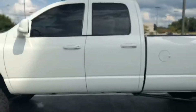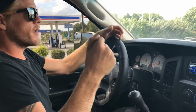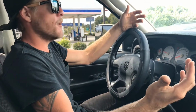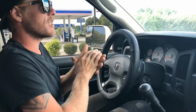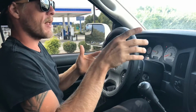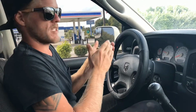So I just had to hop out real quick and show you guys that one more thing. Even over this thing. Amazing. One more thing that you're liable to encounter whenever you lift your vehicle and put oversized wheels and tires on it is your speedometer will need to be recalibrated. Ashton's Jeep, we put 35s on it with 17s. I think it knocked it off somewhere around 5 mile an hour. Maybe even a little better, 8 mile an hour or something. If you're running 55, you're running just about 65. Something like that. We haven't recalibrated it yet, so it don't bother us.